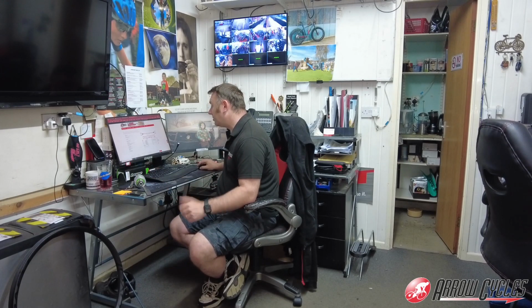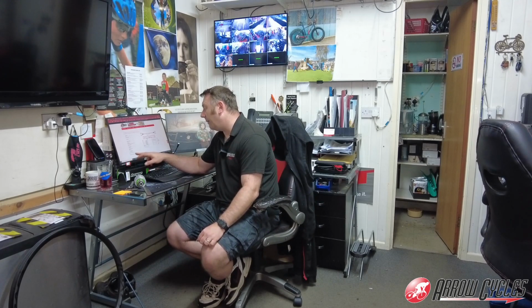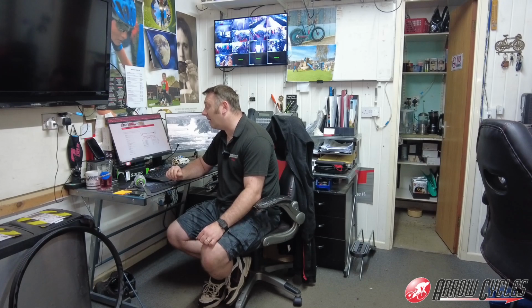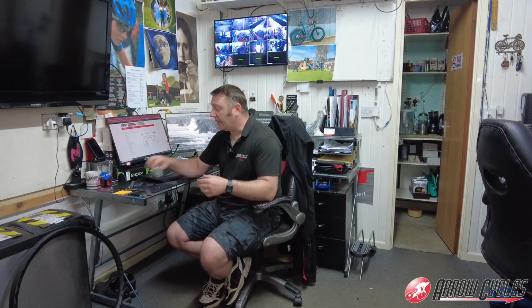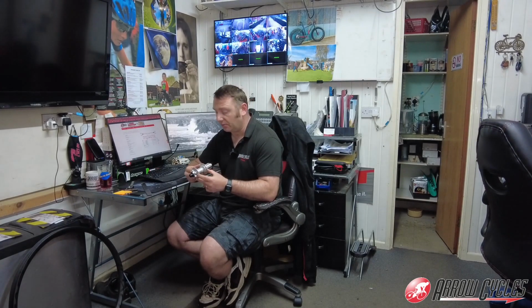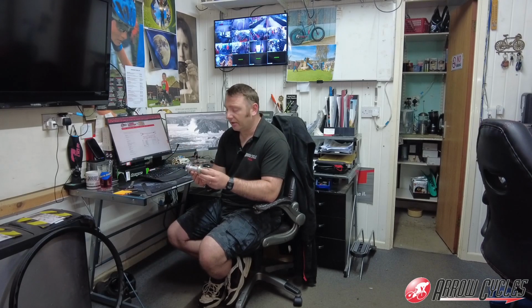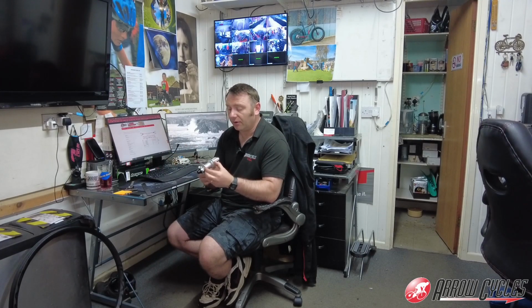So I accept the terms and conditions of this, and we'll click calculate, and it's coming up with a left side of 290 and a right hand side of 289. We have got a little bit of leeway on this, and I'm just going to round this to 290 on both sides. It's quite good with Hope. They often do end up having very similar size spokes on both sides of the wheel. Some companies that have different size flanges on one side to the other, you'll end up with a radically different spoke length, but they all do it for their own individual reasons.